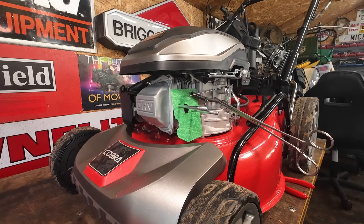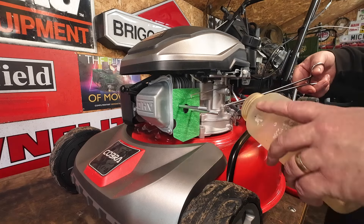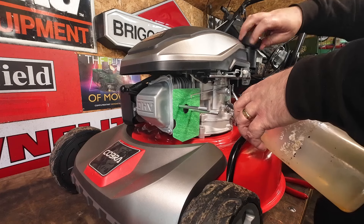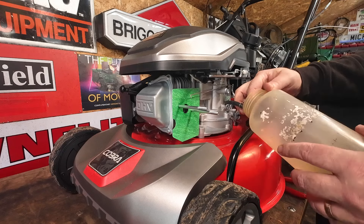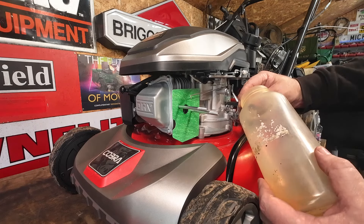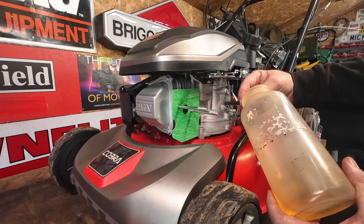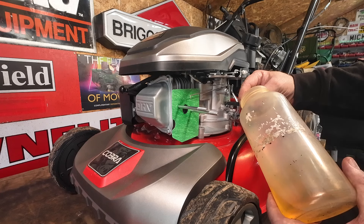Carburetor is now cleaned. Next we need to remove the fuel from the tank that was left in there from last year. I'm going to release my circlips — hemostats, whatever you want to call them — and undo the fuel cap. This lawnmower was sat inside my shed all winter. I'm going to remove all this fuel — you can see it's really yellow, so there must be quite a bit of moisture. This ethanol fuel is not good. Make sure you're using E5 fuel if you have to use any type of ethanol fuel — use E5 and keep your fuel in high rotation.